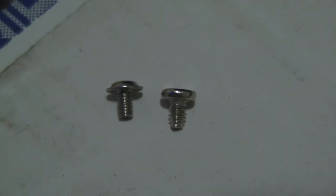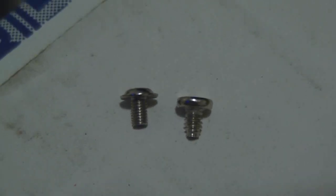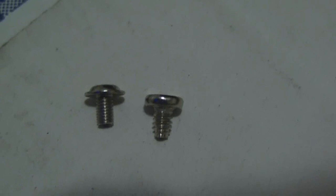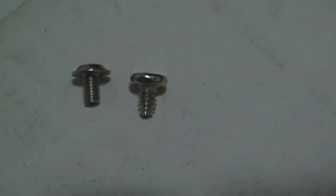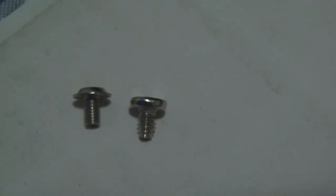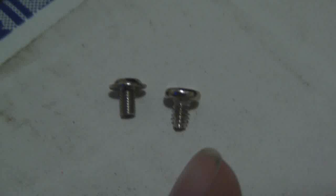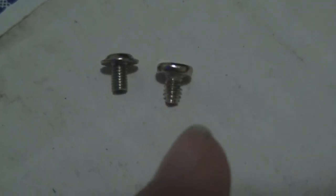Now I've got the motherboard tray in, just a quick tip: the screw on the right has got a much larger thread than the one on the left. The one on the right you will use on a computer case for almost everything — all of your motherboard screws, and very rarely will it be the smaller thread for motherboard screws. This one on the right will always be for your power supply, always your case screws, and always for your hard drive screws.